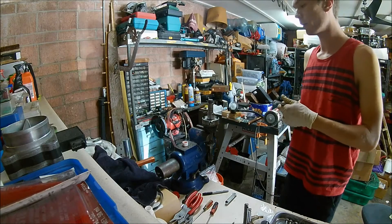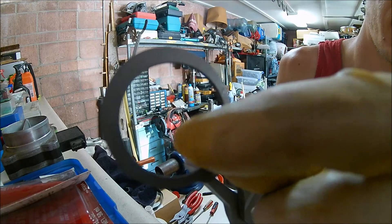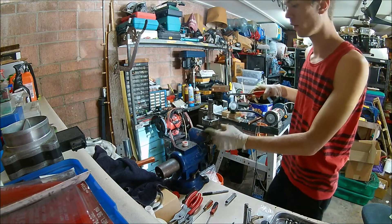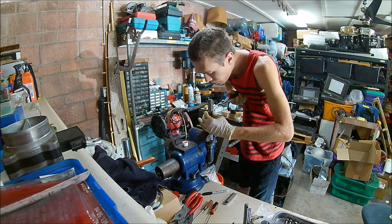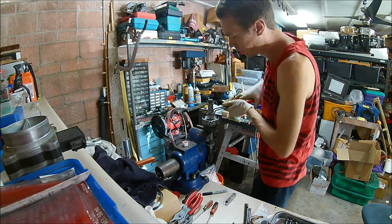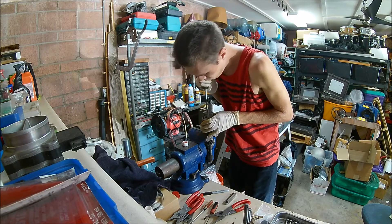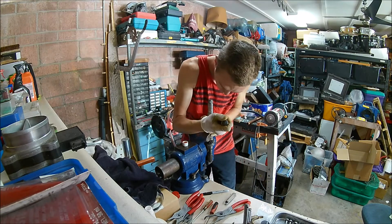I have the right pliers now. There's a beveled edge on one side — that side is going to go against the hub, so facing down. The flat side is going to go up against the load, pushing this way. We're going to just barely spread it just enough to get it over. You don't want to spread these any more than you have to. Go ahead and make sure it's all the way seated.